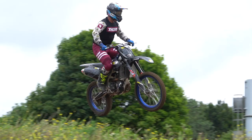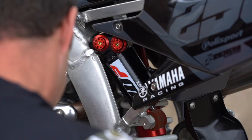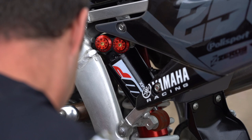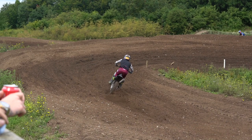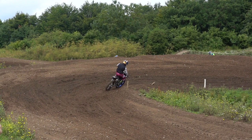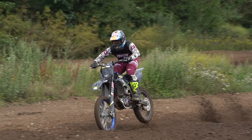Today I was really concentrating on the rear shock. I was adjusting the low speed and the high speed, and what I found by adjusting those two together was that I could really get the shock to sit up when I was coming into the turns. I had the rear shock sitting up a little bit more in the stroke, which just allowed me to come into the turn and into the rut standing, then really squat down in that sweet spot. Previously where I had the high speed it was open too much — about six clickers — so it was just squatting too much.